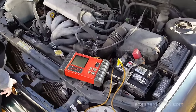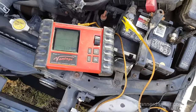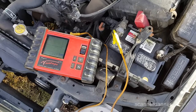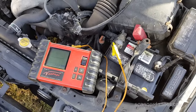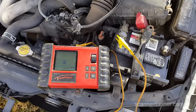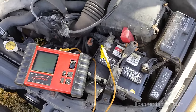One last piece I want you guys to see. Max cranked it for me. When I connected the battery back up it was 12.2 — 12.6 is fully charged and we had it running for about 40 minutes. This should have been enough to get this thing to at least give me one crank. Go ahead and crank it. So you can see that this battery is super dead even after running for 40 minutes.